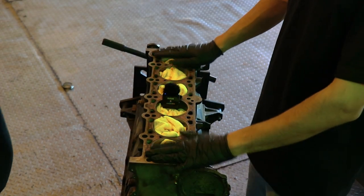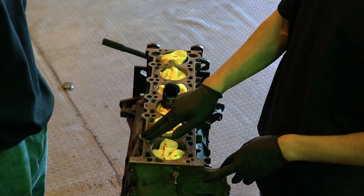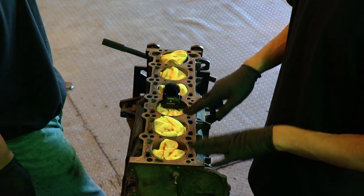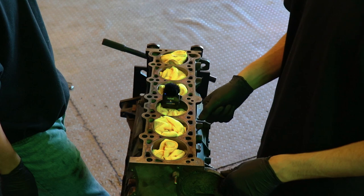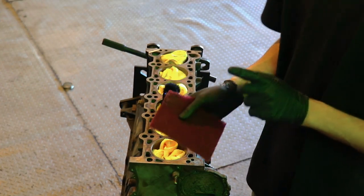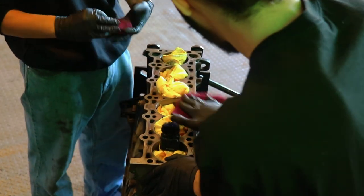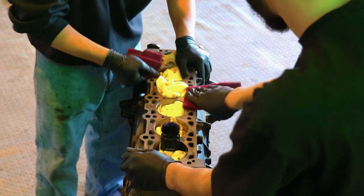So now we got all of our cylinders nice and protected. We're gonna begin by scuffing these up so we can take all of the grime and grease off. For the hard-to-remove sticky stuck pieces you can use a razor blade and get nice and under it. You don't want to hit it too aggressively because then you could scratch this up — so give it a nice shallow angle and try and peel it up. For the rest of this stuff, I usually try to clean these with a scotch brite pad. Just put a little elbow grease in and it shines up pretty quick.